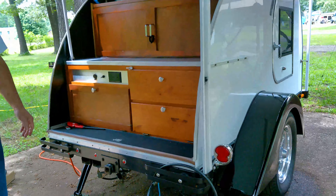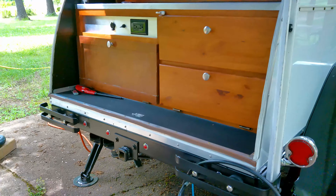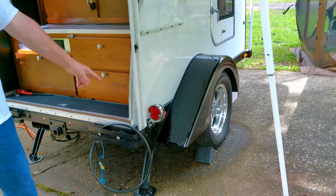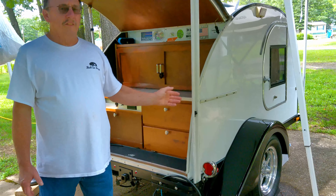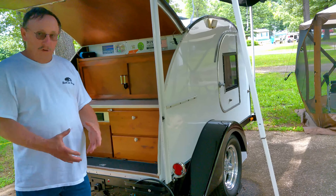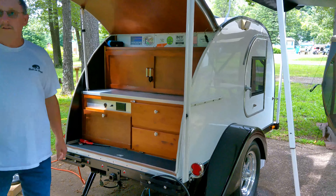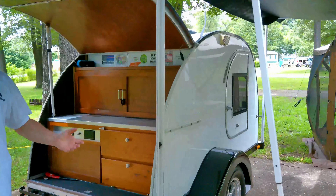He's got some little bumpers on the back and little penny lights — 32 Ford replica LED lights. He put them on when he did the fenders because he was afraid there wasn't quite enough visibility on the back. The taillights from the fenders are smaller, so he added six little LEDs. Those are tied to the taillight circuit, so as long as the lights are on, it gives you extra visibility.